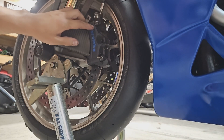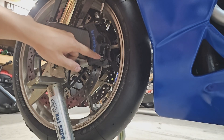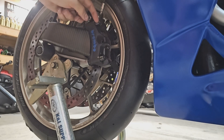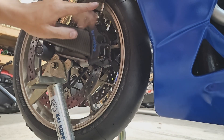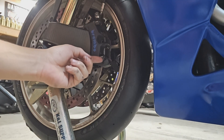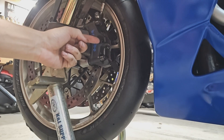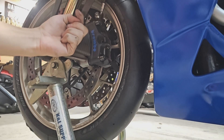We're doing a brake caliper. We've got two bolts. I've got a hole down here in the bottom and a hole over here on this side. So what we're going to do is go from this hole this way to here — it's kind of a Z pattern. The important part is that this needs to be rotating in the tightening direction. So we're going to have it pull this way, and when it pulls on this, it needs to pull this in a tightening direction. So if this loosens, it's going to pull that up and tighten it. And if this one goes to loosen, it's going to pull that out that way and tighten it.